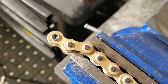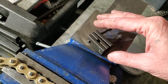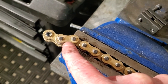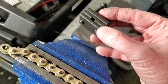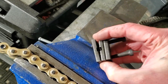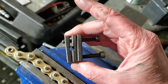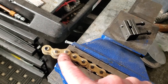The second thing you're going to need is a chain press. This chain press actually presses these plates back on. When you go to put your master link on, they typically have a press-on master link, so you'll need something to press it on with. This is a really cheap device. You can see it's got these little grooves in it — they go over top of these links, which keeps it centered and presses the plate down squarely. It also prevents you from pressing it down too far and squishing your O-ring, so it's really helpful.